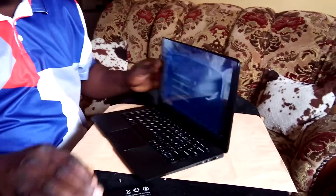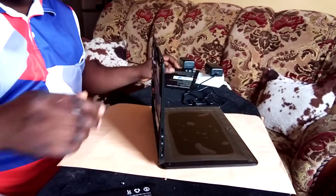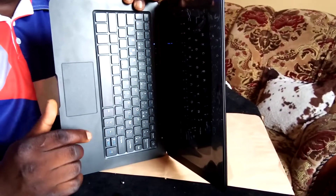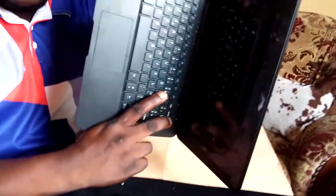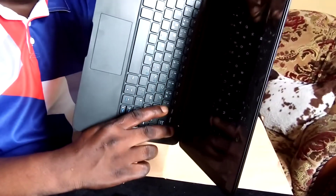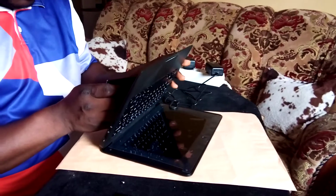I am going to remove the good battery and keep it aside. The battery that doesn't power on the PBHTV is the original one. When you plug the charger, the blue light will shine. In the first generation PBHTV laptops, without the battery you could power it on, but with the second generation, the power button receives energy typically from the battery, and the battery can only charge when there is a little bit of charge inside. So we are going to use the good battery to spark up the PBHTV and activate all the ICs for current to flow and reach the original battery.